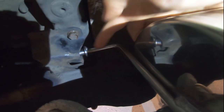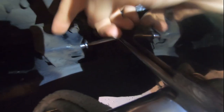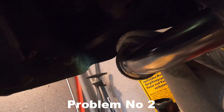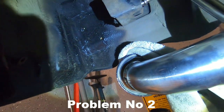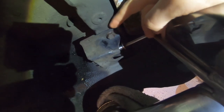I will remove this welding spot, and so I can mount the holder here. That's where the rubber sits, and I can turn that around again, so everything is like standard. Here we have the 105 millimeter tip from the back, and it touches the metal here, so I think I need just a 5 millimeter spacer between the standard rubber holder and our chassis on both sides.